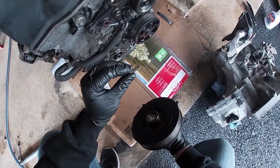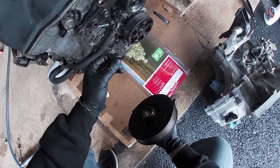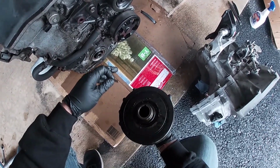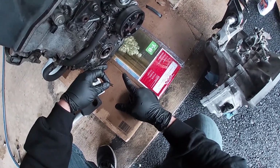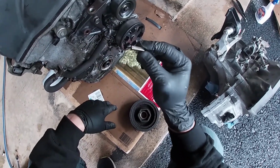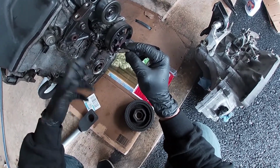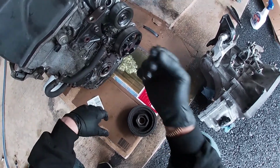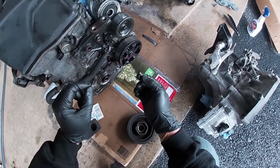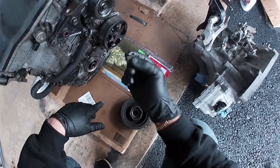So this is the reason why my engine leaks. When I was doing the engine swap, after I modified the oil pump, I was about to close the engine, put the oil pan back, and then this little pin fell inside of the pistons, and I couldn't get it even with a magnet. I couldn't find it, so I had to take out the girdle to find this stuff, and I was running out of silicone, so I had to put small amounts of silicone on the girdle, and yeah, this is it.